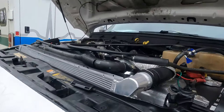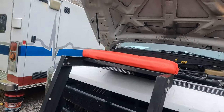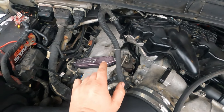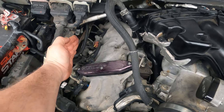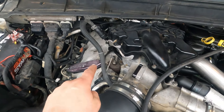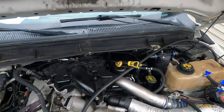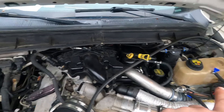This truck is heavily tuned, so that's one thing to take into consideration. No EGR cooler — one of the first things I asked him is 'do you have an EGR cooler?' If you're looking at your truck it's going to look like a big square box mounted right here. His does not have that, it's been deleted. That's the only other real possible way you're going to get pressure into the cooling system.